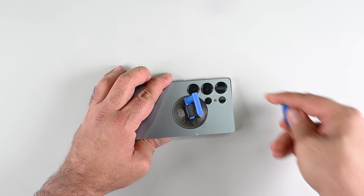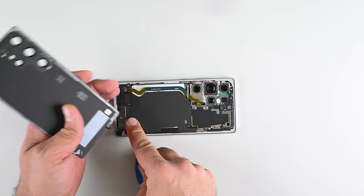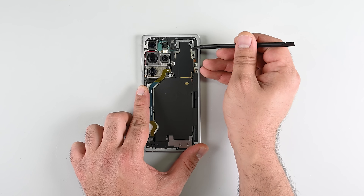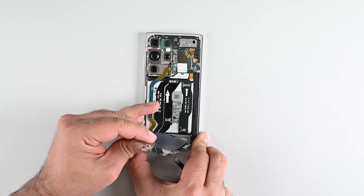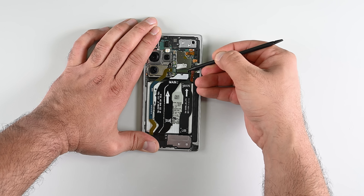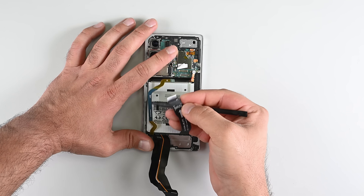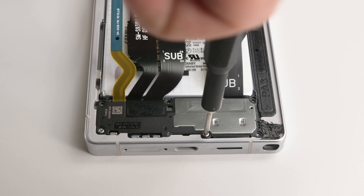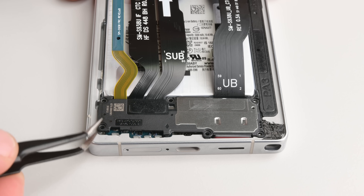While this removal is possible without heat, it's still a bit of a struggle, and applying some heat from a heat gun or heat mat would make things much easier. With the back cover off, the next component to come away is the wireless charging coil. After that, we need to disconnect the interconnect cables leading from the daughterboard up to the mainboard. The bottom half of these connectors are still plugged in underneath the haptic feedback and speaker module, so that comes out next, and the interconnect cables can now be fully released.